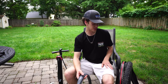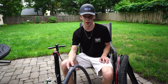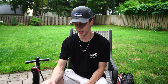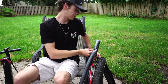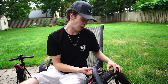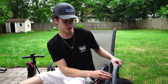Simple as that. All right, so if your tube went flat it's worth checking what caused it, so you don't put a new tube in and instantly puncture it again - which happens more often than not. Just inflate the tube to the point where it starts leaking and you'll be able to hear it. Find where the hole is, compare it to the rim and tire based on where the valve is, and look in the tire in the relative area it went flat. You'll probably find a thorn or something like that.